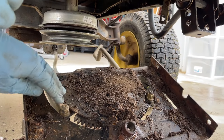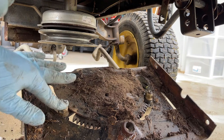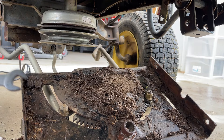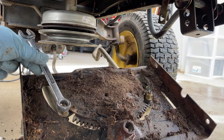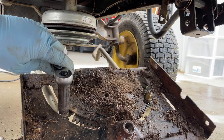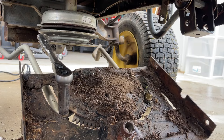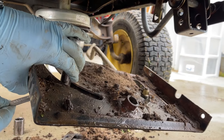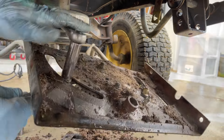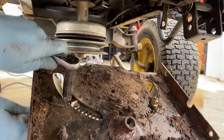This thing was really dirty — I'm still going to have to clean it up some — but now we just need to pull these steering arms off. The top one is a 15 millimeter. I've got a socket for that. The bottom one I believe is a 13 millimeter. Yep, got the 13 there. You're going to do that for the other side as well.